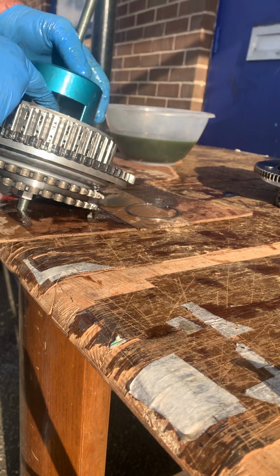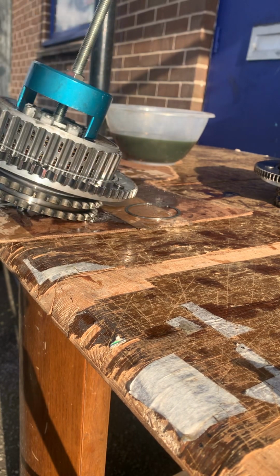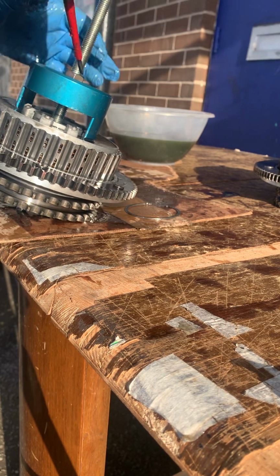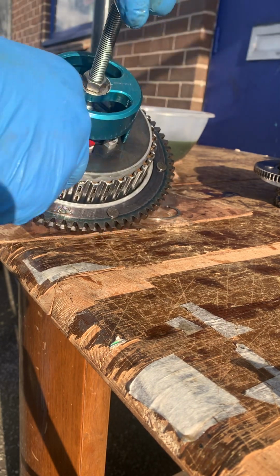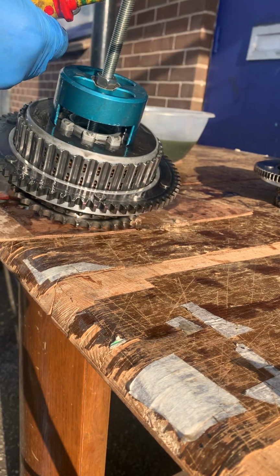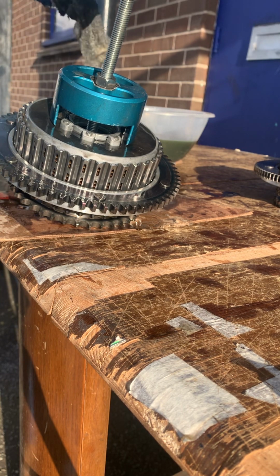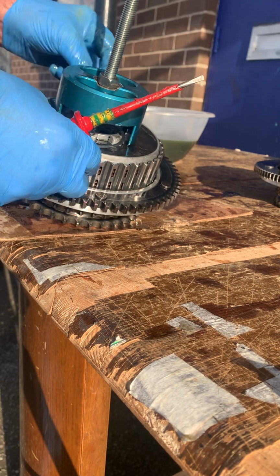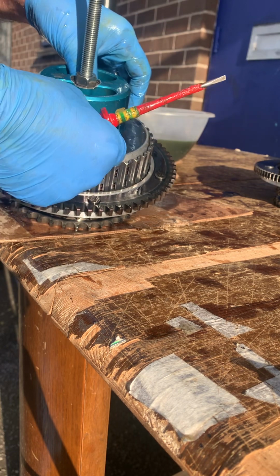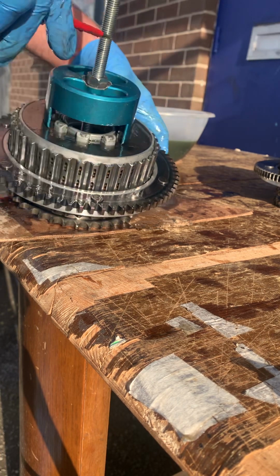This thing here, if you can see it, goes right down. Press him in the groove like that, so you can see this is right down. Take our circlip, clean him up, put him around here. The hard bit is you've got to get it into the inside of this basket, so we've got to press that.